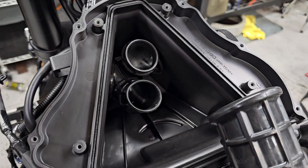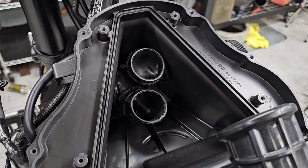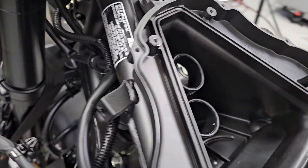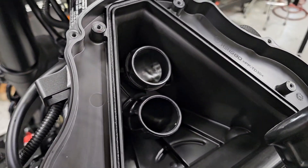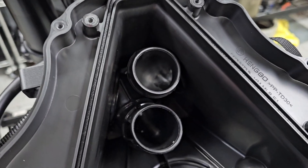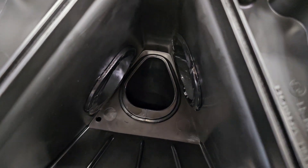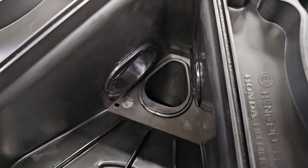So we're going to see what effect removing these has on performance. What we're actually going to do is just cut these flush against the side of the airbox. You can't remove them entirely like many other bikes because these snorkels actually attach to the ducts on the side there, so you do need those in place. We're going to take an X-Acto knife or a razor blade and trim around the edge to cut them flush. And here it is now that we've modified them and cut them flush with the side of the airbox.